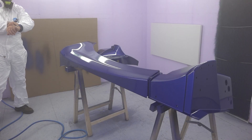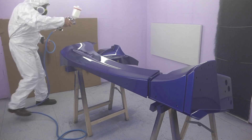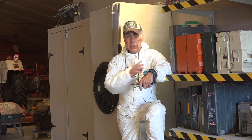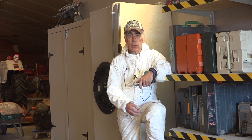I'm going to give it about two minutes and then I'll do the last coat. I've just placed the last layer of clear coat, and now I'm going to let it dry. I've set the paint booth to about 30 degrees centigrade and I'm going to let it sit there for a couple of hours so it can cure nicely.